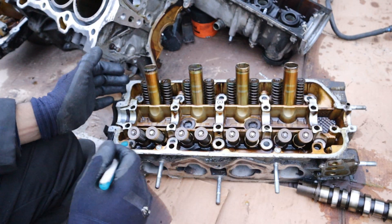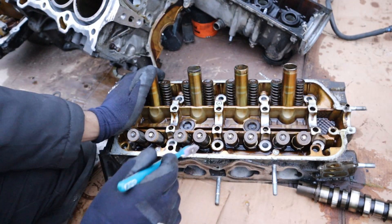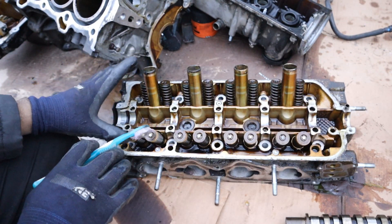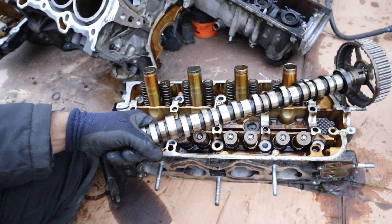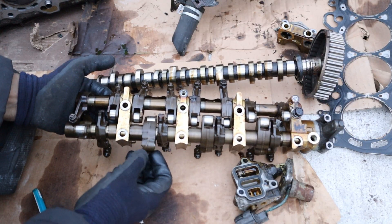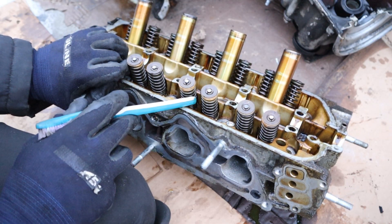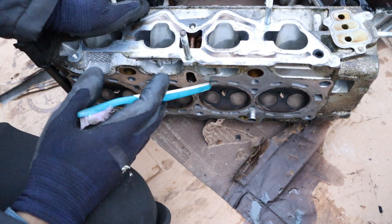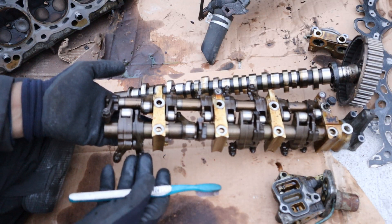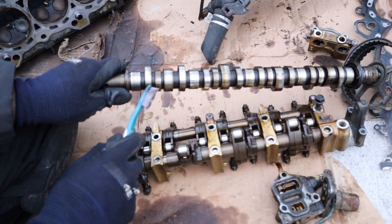What really makes these engines unique is that they incorporate both VTEC and EGR. Unlike a dual overhead cam engine where you have two camshafts — one on the intake side and one on the exhaust — directly acting on the valves, in this case you have a single overhead camshaft driven off a timing belt. That camshaft has to control both the intake and the exhaust side, which is why you have so many cam lobes on here. Sitting on top of that camshaft is this roller rocker arm system, which takes the motion as the camshaft rotates through this roller and transfers it to the rocker moving up and down. That up-and-down motion is then acted directly on the valve, held up by the valve spring — that's going to open up the valves. The more you open the valve, the more air comes in for the period that the valve is open, and that's where the VTEC system kicks in. In essence you have these two roller rocker arms following two different cam profiles side by side.